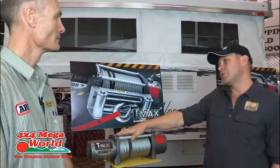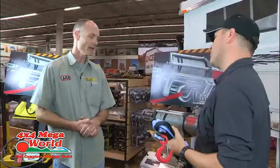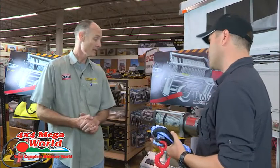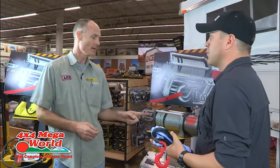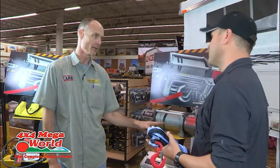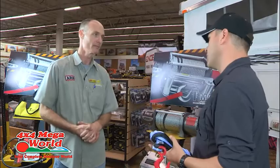What are the factors to consider when selecting the correct winch for your vehicle? The weight of the car. You can always go bigger than you need, but smaller than you need — you're wasting your time. That's our job to advise a client. A lot of guys don't realise that a winch isn't always equally strong — its strength differs as the layers on the drum get smaller.